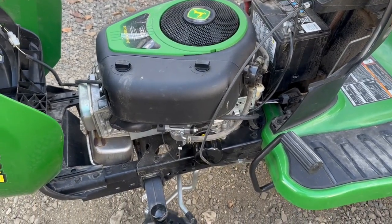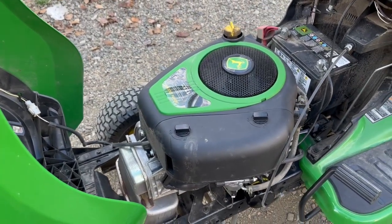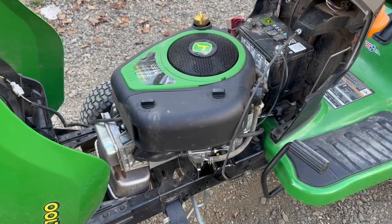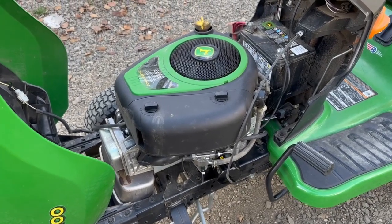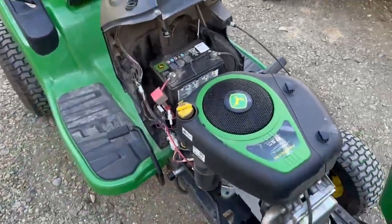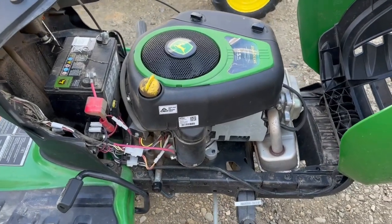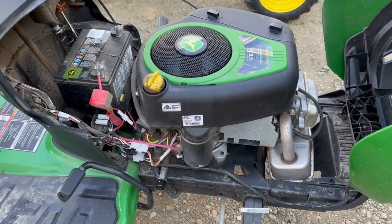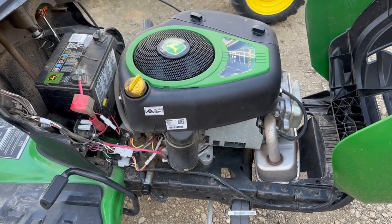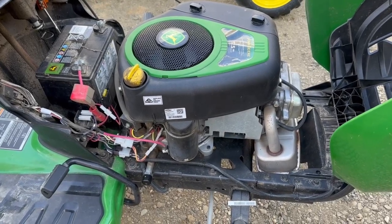You do have an oil filter on there you can service, a serviceable air filter and everything. My old 1980 210 doesn't even have an oil filter that you can service on it, so a little bit different. But they're a decent little engine. They're not intended to be a long life engine. If you take care of them, they'll last a good long while, but they don't have anything on them that makes them any kind of extended life, or they're not a commercial series engine.